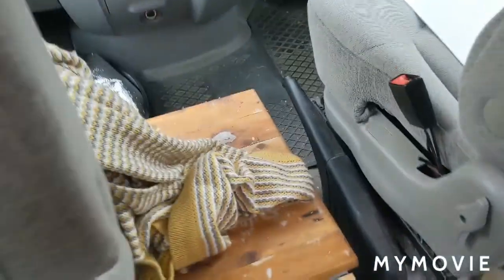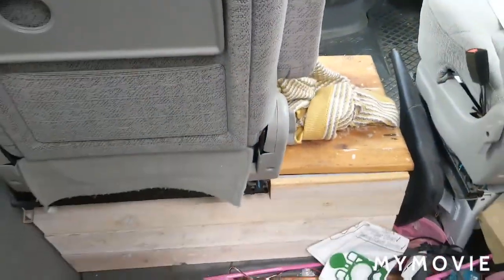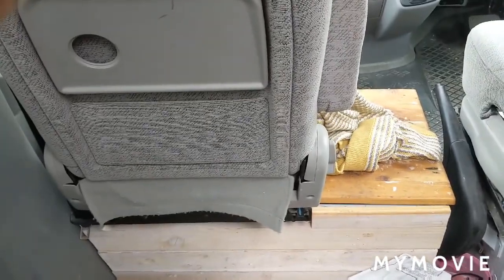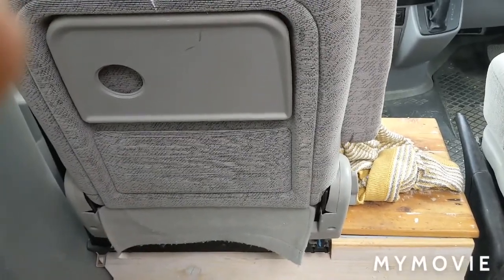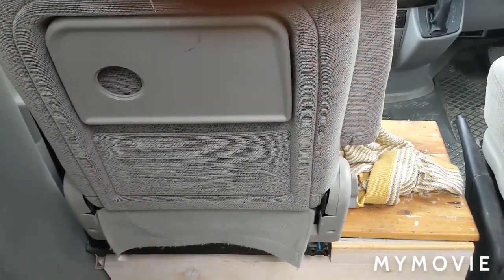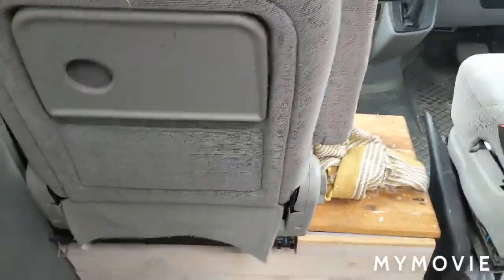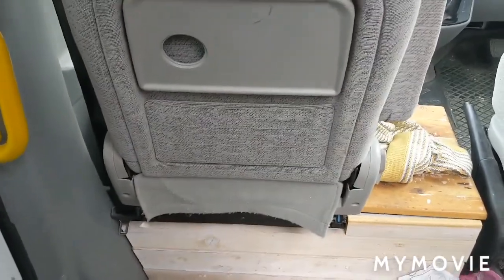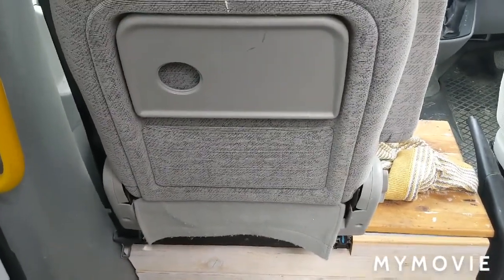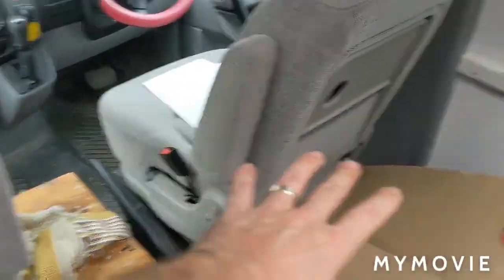A little bit of storage at the front as well. I utilised the middle box — that's actually the double box that both seats sat on. Took the seats off, we got two new — second hand — captain seats and modified it. Then put some thick angle bracket, angle iron on the base, and bolted about six screws into them. So these rotate. And then we have the table here coming off that.